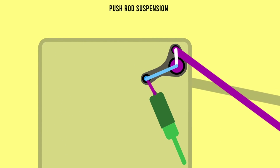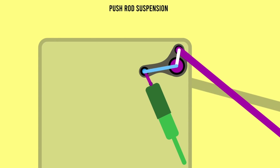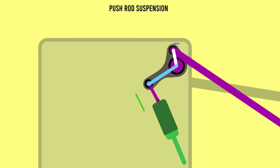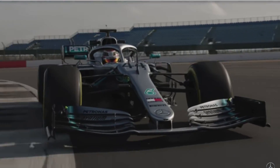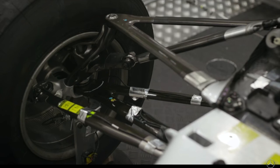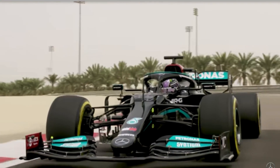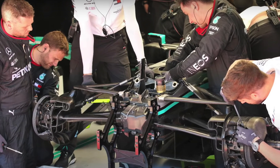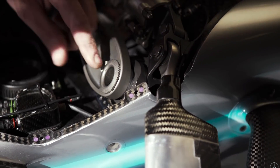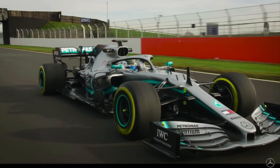Here you will realize how handy are those cantilever beams from physics class. We can magnify damper force with small adjustments to the rocker arms connected to the push rod and to the damper using momentum rules. We can mount different parts of suspension at different distances from the pivot point, which changes the length of the moment arm and magnifies the motion into the piston of the damper, hence the damper force. We can mount the damper further from the pivot of the rocker than the push rod, translating small motions in the push rod into long motions in the damper. All four wheels behave differently at every part of the track, and we need to find the perfect balance to allow the car to grip the road by adjusting inboard spring settings and mechanical balance of dampers to control grip from the rear axle to the front axle.